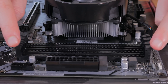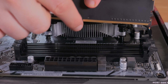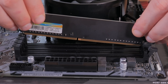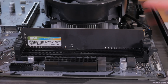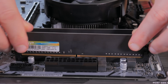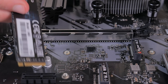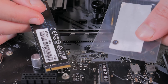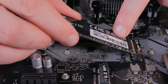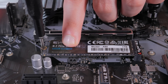We're going to install our RAM sticks into slots 2 and 4, so start by opening the top clip on both of these slots. Take your first stick of RAM, orient it so the cutout matches the notch in the slot, lower it down, and press on both sides until it clicks into place and the clip snaps shut. Repeat this process for the second stick in slot 4. Now bring your attention to the top M.2 slot and grab your M.2 drive and screw. Line the notch in the drive with the notch in the slot and insert it at an angle. Once in, hinge it down and secure it with the M.2 screw using your smaller screwdriver.